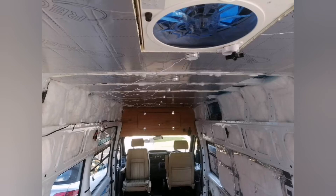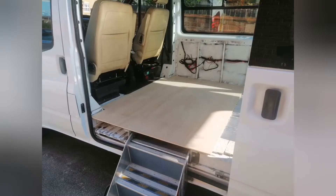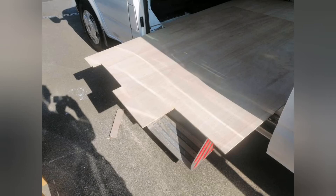As I was doing this I could really tell the insulation was working — the van was starting to feel different, and it's a big step. I felt it was time to get the flooring down. I started laying 12mm plywood: got full sheets, laid them in, marked and measured, cut with a jigsaw, and slotted them into place. I stuck them down with Sikaflex and put self-tappers in on each corner.